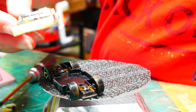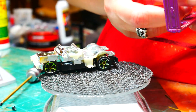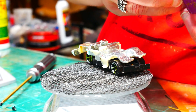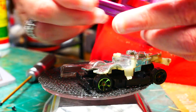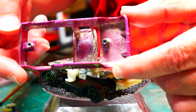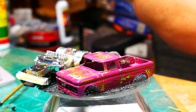What's left of the chrome, we're going to go ahead and take off with some Easy Off Oven Cleaner. It has a smoked windshield in good shape, and of course the casting itself — as you can see it's got a lot of crud on the inside. It's got some corrosion, so we're going to get it in the stripper and see exactly what we're working with after we get all the paint off.